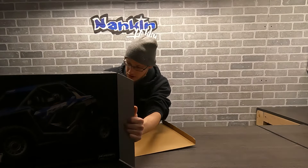I have not really opened this up too much yet. Other than just this box right here, there's nothing else inside the box, which makes it nice and easy. This is a two-cell or three-cell rated vehicle. Your average battery size can be right around 4500 to 5500 milliamps, which is what Spektrum or Horizon Hobby recommends for this.